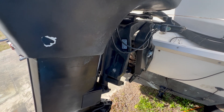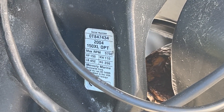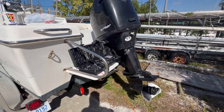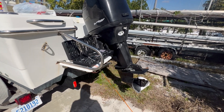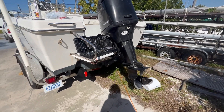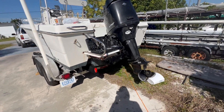Shop Don't Stop. We are doing the impeller on this 2004 150 horsepower Optimax saltwater Mercury outboard on a 24-foot Sea Fox. What you see when you are having impeller issues is the engine kind of mid-range starts to heat up because that impeller is not moving enough water to cool the engine. We have a smart gauge on here that will beep at us, tell us the temp's too high, kind of put you in limp mode. You have to restart the engine, let it cool down, troll around at low speeds or even get up on plane and cool the engine down by moving more water. Today we are going to be taking down that lower unit and replacing the impeller.